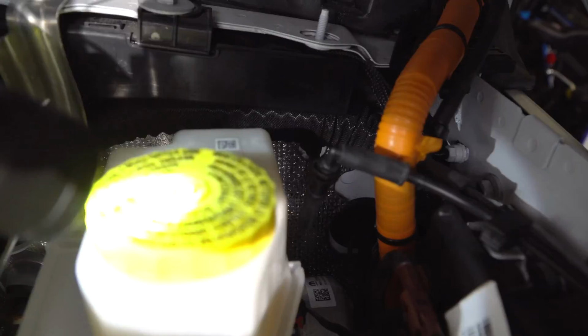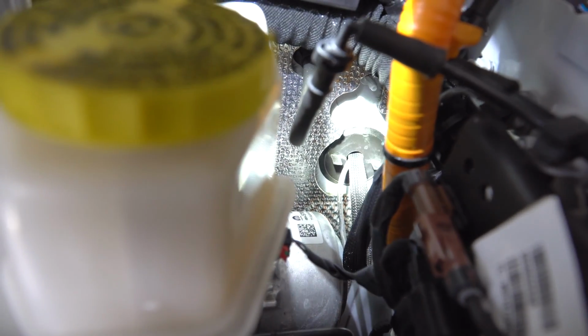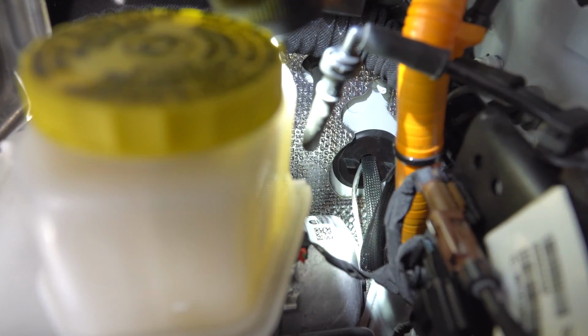So we do have our wires. We have our wires going inside that hole there. We drill the hole with our step bit. I will let you in on a little secret. When you put your wires in there, you don't want to tug them straight in. Let a little loop drip down.